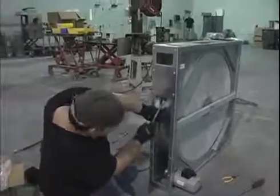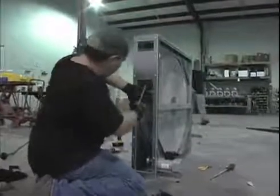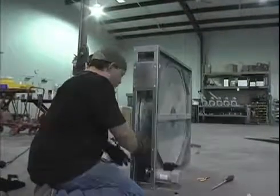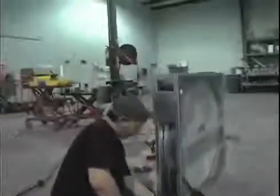Now we'll go through trying to stretch the belt. Rotate the wheel around and continue stretching the belt until we've gone around a full revolution. When we hold the belt down, when you have the proper length, it should be about even with the center of the motor shaft. We'll take a long flat head screwdriver and make sure that we get it down flat inside the drive pulley. If you turn it sideways, it will bend the lip of that drive pulley and you'll have to replace it.